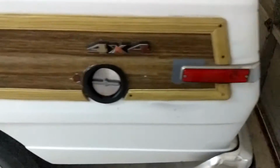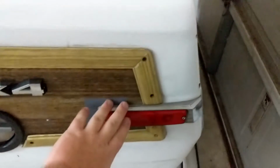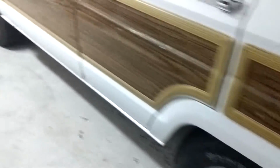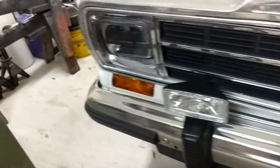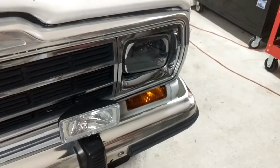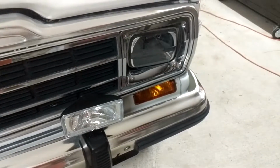Yeah, he thinks we're going for a ride. I redid all the lights on it. All the plastics are brand new. The original ones were all cracked and faded, and they look nasty. That's one of my biggest pet peeves, crappy electrical, and so I basically fixed all that, and it's got LEDs all the way around. And I put in the right flashers, the LED flashers that are underneath the dash to control them so that they actually work, because the old school style is like a thermal.